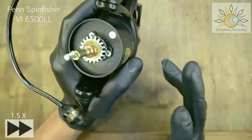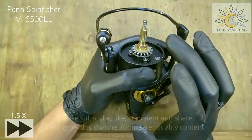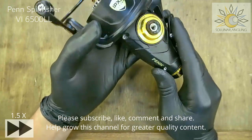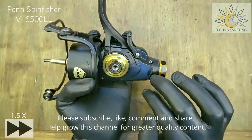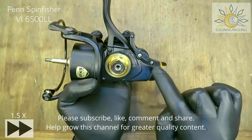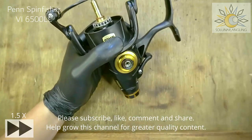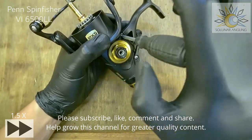In order to remove the rotor, you have to remove the shaft. And in order to remove the shaft, you have to remove the side plate. So we're going to do the side plate first. As you can see, this one has 6 screws on this side. Do not remove this screw. What you're going to remove primarily is only these 5 right here, and not this one. So let's just go ahead and remove these 5.